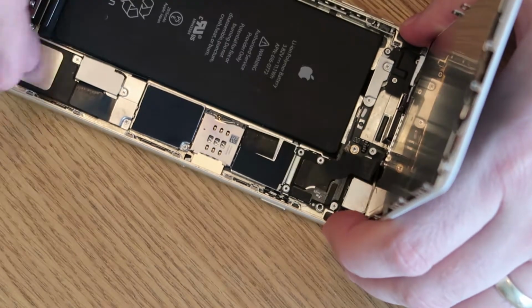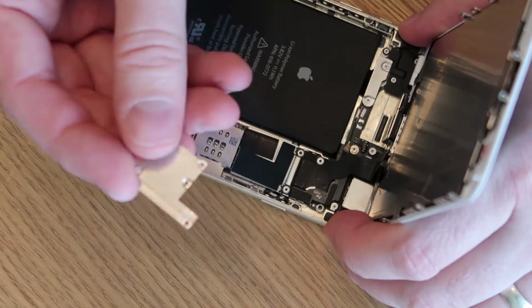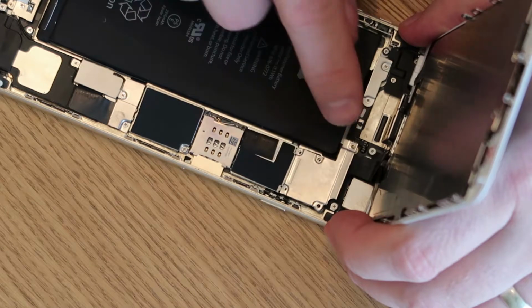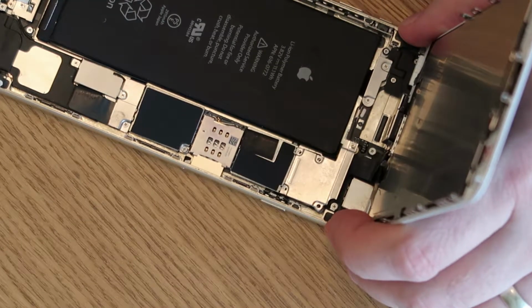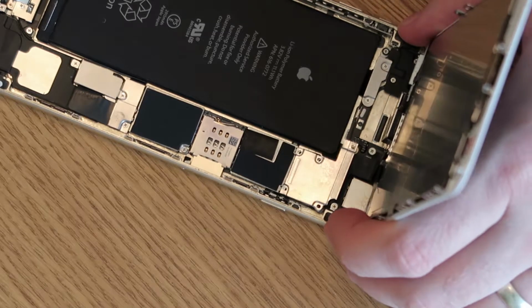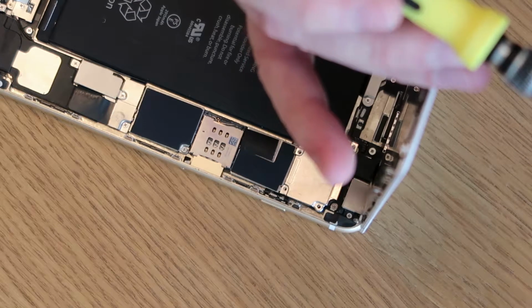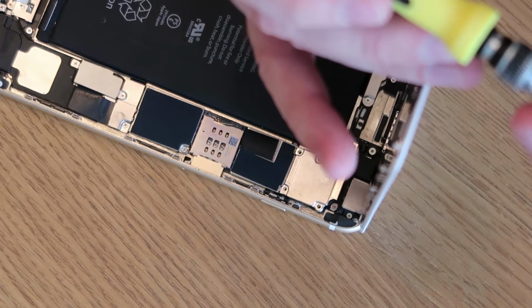Always keep the screen at a little bit of an angle while you connect them. You might need to lean it up a bit when you get to the last connection. Then over the top we put a metal cover plate that comes with it. You've got 5 screws that hold it into place. Now, I bought this as part of a fitting kit with the home button from eBay. I will try and link it in the video notes below.